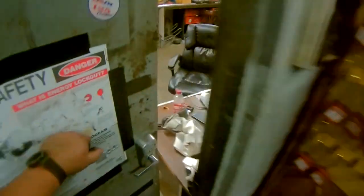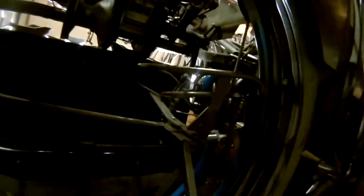One eighty on 22. Never mind, it was on mid-cycle. Clearly, another ball just went through, because we got pins dropping. There's no ball here. These should all be adjusted similarly. Got a personal ball. Boom. Up, through. A little bit of bounce to hit top, so it's still a little tight here, or a little loose. But we can go with a little bump.